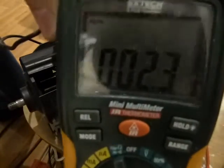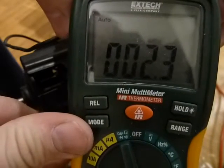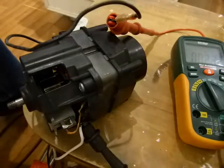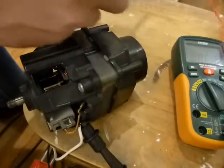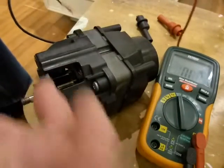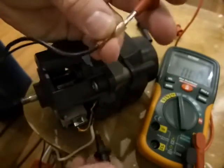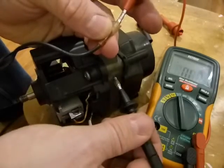For quiet measurements, I selected resistance — measuring ohms. It reads 2.2 ohms, measured from neutral to the hot wire. Then a couple of continuity measurements: set to continuity mode, you get a beep when there's continuity. Going to the hot — we have continuity where we measured resistance. We also have continuity here. Nothing to the housing. We also have continuity to the wire itself, or to the brush — but not to the clip. The clip is not conducting, just the brush itself.